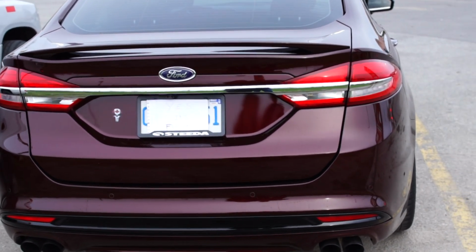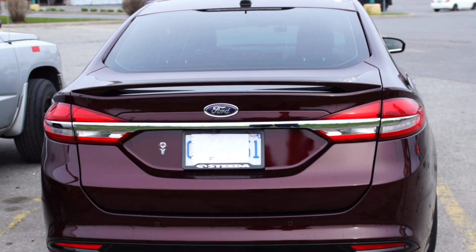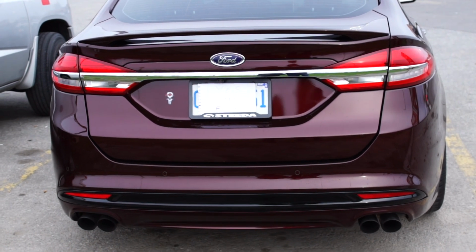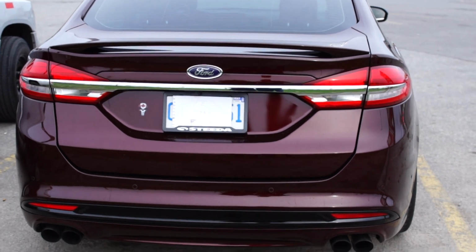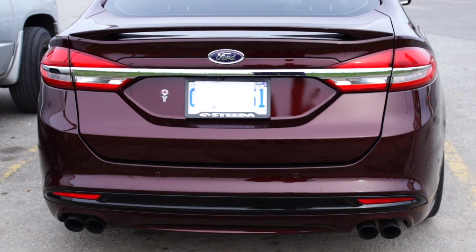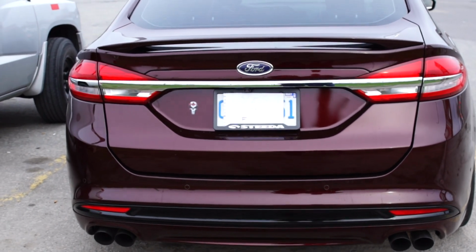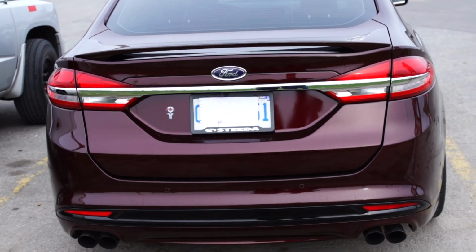And another recommendation, one-step colder spark plugs. I strongly recommend that. Motorcraft sells one. I'm running the NGK Ruthenium ones. Again, I'll try to provide that in the link. And lastly, but not least, high quality gas. EcoBoost loves octane. On my car, Ultra 94 octane, and I had some Boostane. I tried to get as close as 100 octane, but high premium fuel, the EcoBoost just wants that.